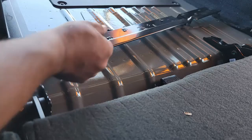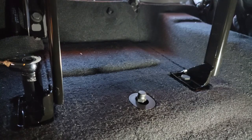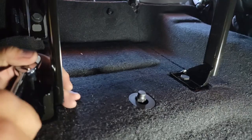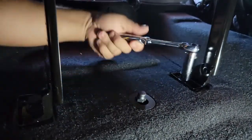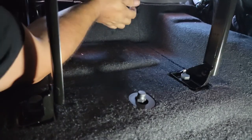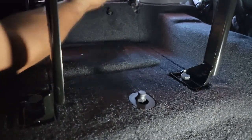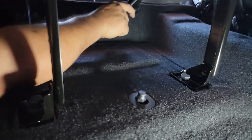Now we need to move to the seat section, and here we have some primary bolts to get to. Let's get the floor mat out of the way. The main bolts here, there's 4 of them on the bottom. These are very tight. Again, this is for what makes the seat mount to the floor. Seat belts are in the area, so obviously these are going to be pretty tight for safety reasons. So you may have to use a wrench and a little bit more force to get this loose before you use our light duty impact to get things out. Here, just get all of those bolts loose. Don't forget the one here that joins the 2 in the middle.